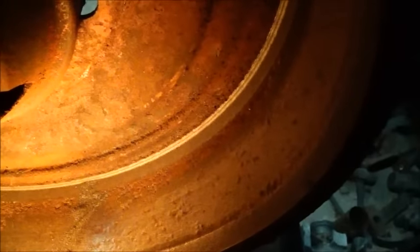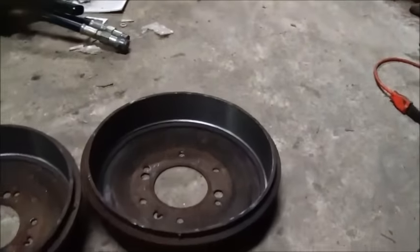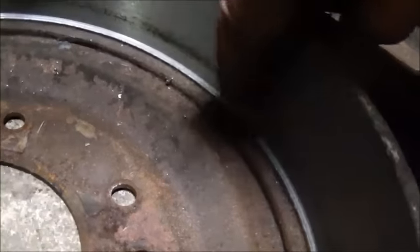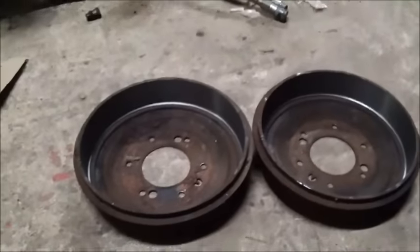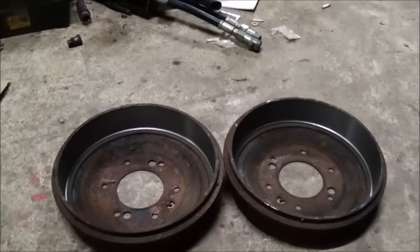Okay, if you can see it — it's cleaning up real good, but still got a lot of pitting in there. So we're going to go on and take it down until we get the pitting out. I think we're going to be fine on thickness because I don't think they've ever been turned before. We'll just keep at it until it's gone, then check it. Both of the drums are turned and finished up. You can see a sort of a dark spot through there — you really can't feel it, but I didn't want to go any farther than I had to. They're well within specs. Evidently they hadn't been turned before, and if they had, I probably wouldn't have been able to get them right, but they're good to go.